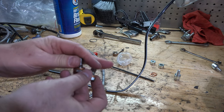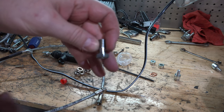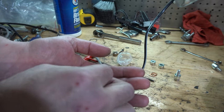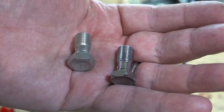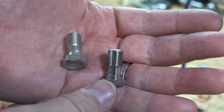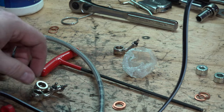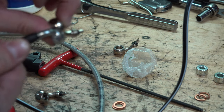As you can see with this one here, it has a smaller top to it. Whereas the right one that was in the package has a much bigger area. So I was using the wrong size banjo - the original one I had bought was very thin, whereas the real correct ones are very, very thick. So they add on a lot more.